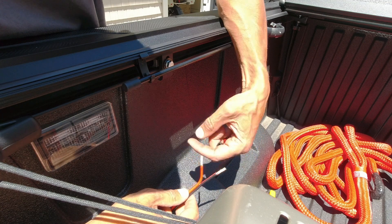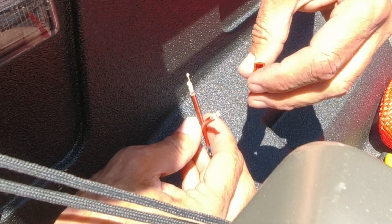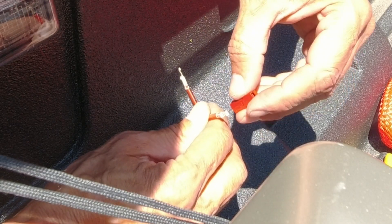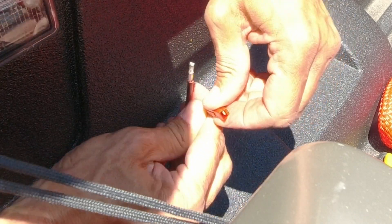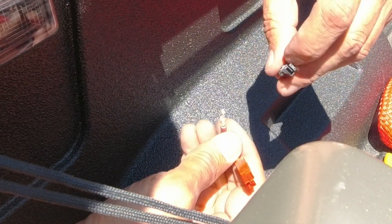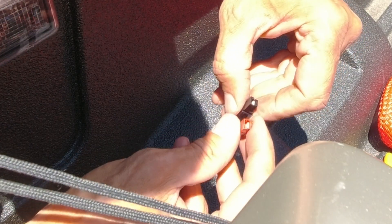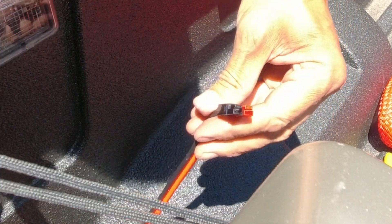Positive on the right, lip facing up. On the insulators there's also a little metal clip — that also goes up and hooks behind the lip. Align it, press it in, make sure it clicks, and give it a good pull. The cheap ones you're going to have trouble with — they don't really stay put. Same on the negative side: push it in, click. Then push the two Anderson connectors together — there's a tongue-and-groove setup. There you go, you're good to go.